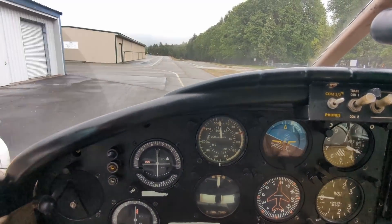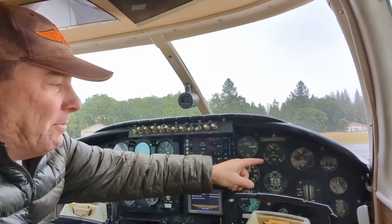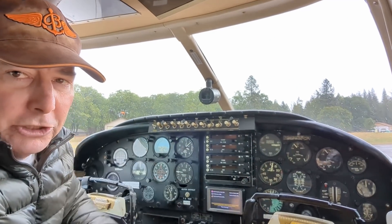Let's go warm it up for a compression test. One of the first things you want to do on an annual inspection is warm up the engines for a compression test and an oil change. We don't need to do the oil change on Harvey's — we've still got plenty of time on the oil. But we are going to do a differential compression test. We want to warm the cylinders up to get an accurate reading. We're looking for about 100 degrees on the oil temperature, and by that time the cylinder head temperature should be just right.